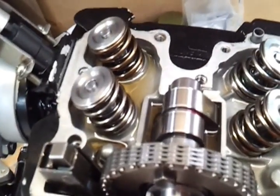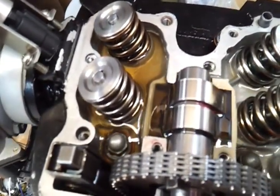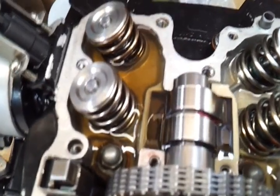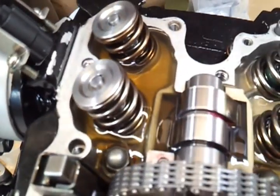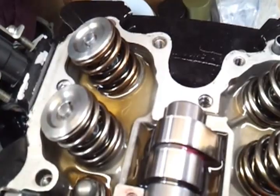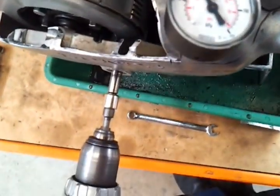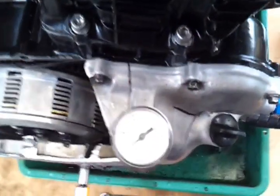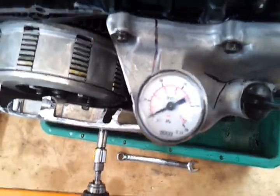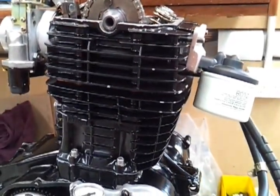If I increase the RPM of the drill to simulate — this would be somewhere around 4,000 engine RPM — you'll see how much oil is pouring out of there now. There's a hell of a lot of oil that comes out of these pumps and out of these engines. So I think we can safely get rid of one myth: that there's a lack of oil up to the camshaft on these engines. As you can see, there's heaps of oil that gets up there. This oil pump is a standard oil pump, just slightly over stock size — essentially it's a standard one. We're building up — it's under 15 PSI there. Of course the PSI's not important here, with a lot of roller bearings and so on. That's right down to a couple PSI when it's idling. This is a straight 20 weight oil that we're using — of course it's at room temperature, but it's indicative. It just gives you an idea of where the oil's going. Not totally solved the mystery, but I think we're a little bit clearer on it now.